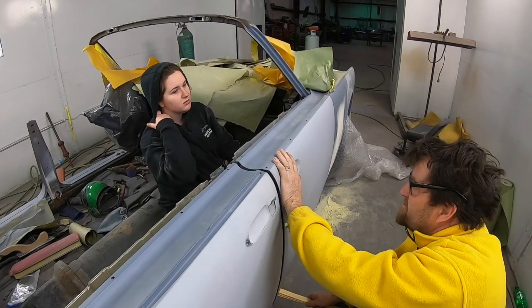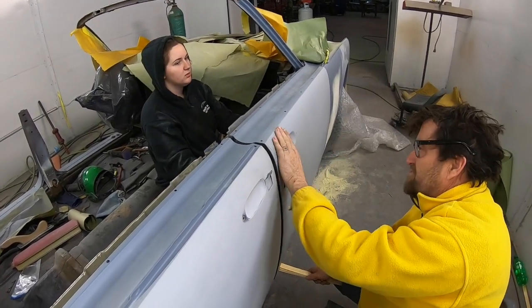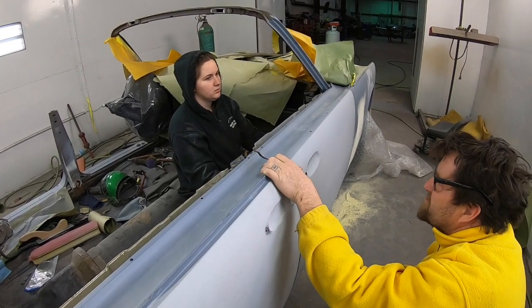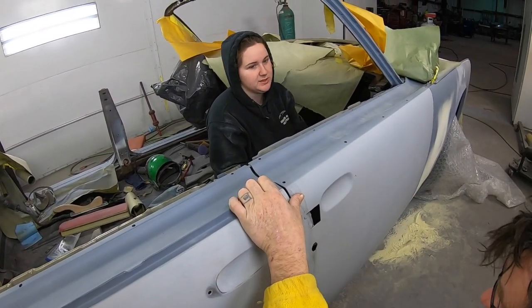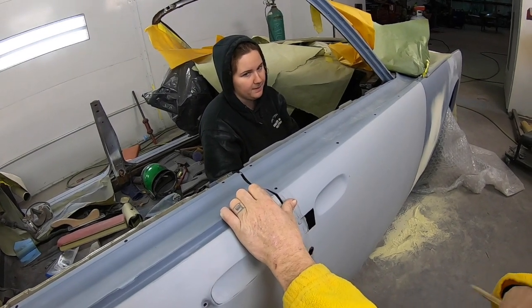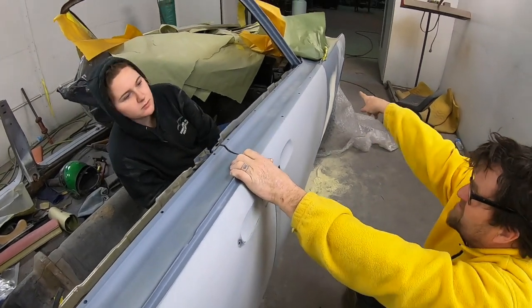But it feels like the one you did last on the top and the one you just did on the bottom felt like it pulled on me. Alright. We're in the same place, a 16th low. I mean, we were so close. But is that because the hinge is sagging? Because of the bushing? Might be. I checked the bushings in this back one, but I didn't check that when we put it on.